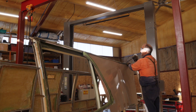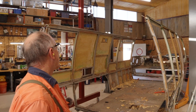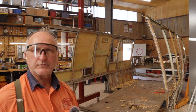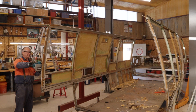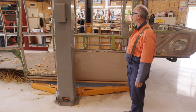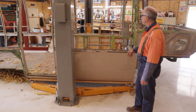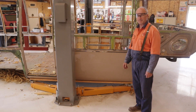I could take the saw and just slice down the middle. One down, three more to go — two little ones in the front and this other big one. Moving right along. There's not a lot else holding this framework on here, this skeleton. Based on what's happened back there, the welds holding these spines — these ribs — onto the floor are pretty brittle.